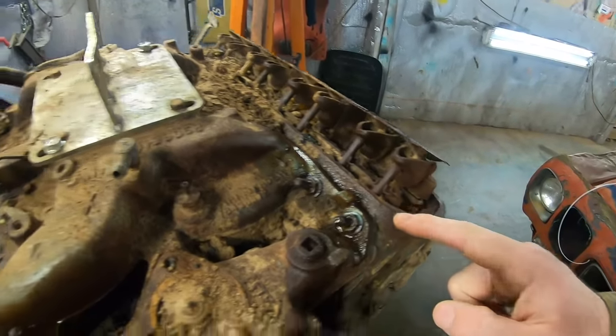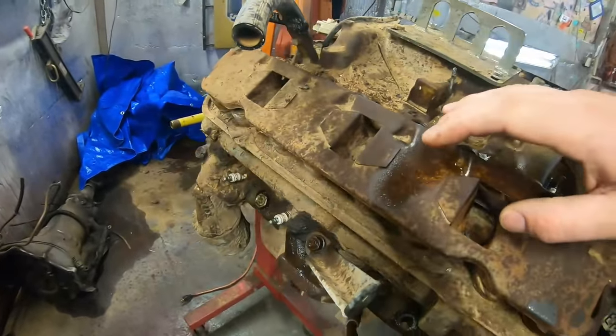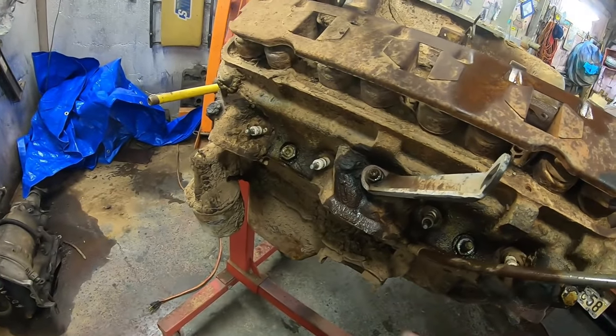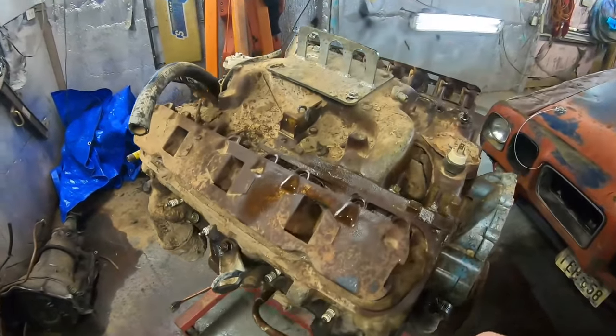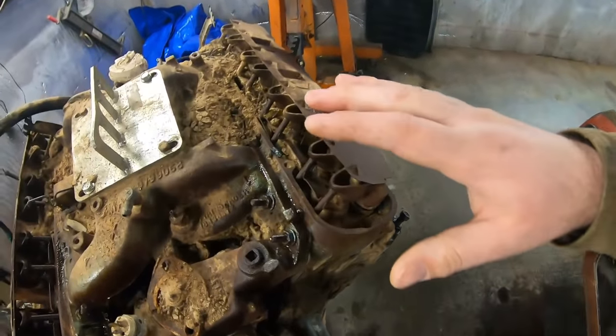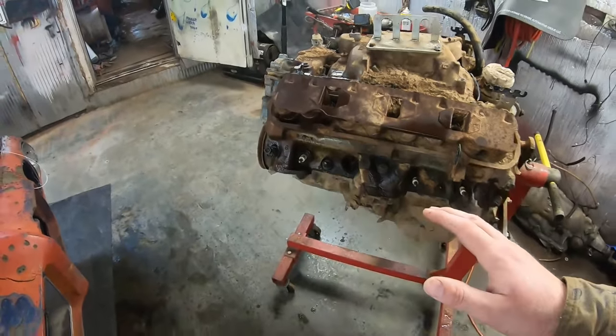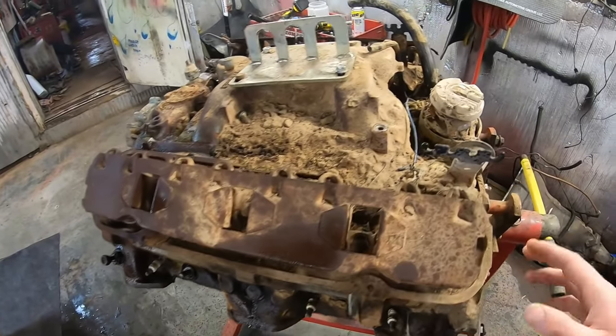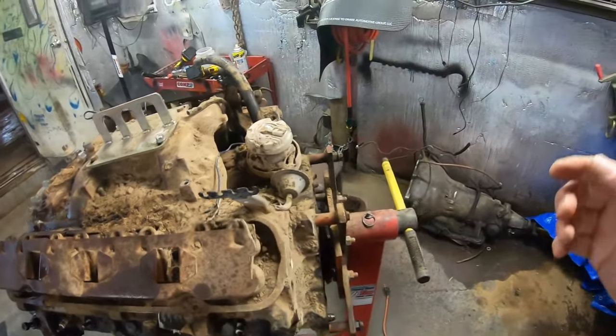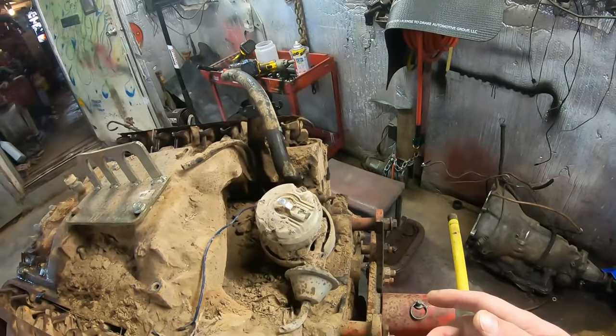She's got screw-in studs in the heads, so they're big valve heads. These are number 13 heads, 211, 177 valves. Very good head, 10.5-to-1 compression. So even if we can't use anything else, as long as we could salvage these, our time is well spent here. A lot of things on this engine are probably worth quite a bit of money.